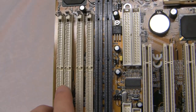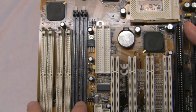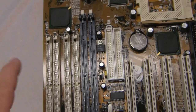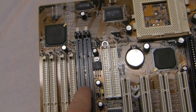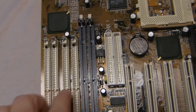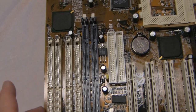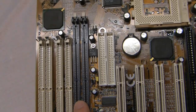Another cool feature: you have four of these white ones right here — four SIMM RAM slots — and you have two DIMM RAM slots. That way, if you're using DIMMs in slots one and two and you decide later on you want to upgrade your memory, or just the opposite — if you have SIMMs in all four slots — you can just plug in two DIMMs and you're on your way.